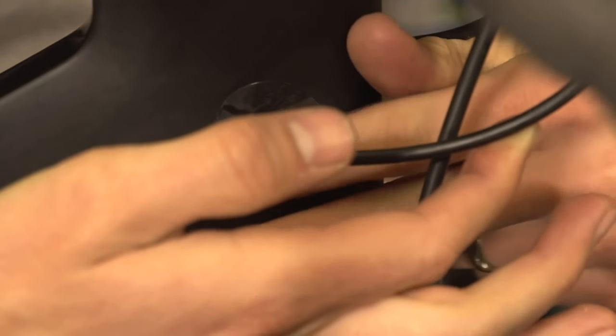Finally, the rattle. This can be a fairly easy one to diagnose and solve because it's the loudest noise of all. First point of call is to look at where your outer cables are going near your frame. If there's any paint missing, that's a certain indicator of a rattle causing that noise. If you've got that, it's worth getting some self-adhesive frame protector and placing it where that rubbing has been occurring.